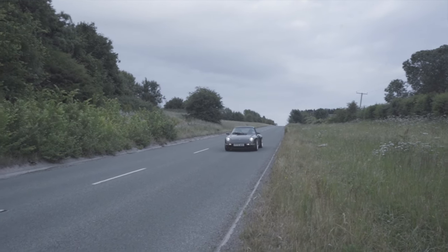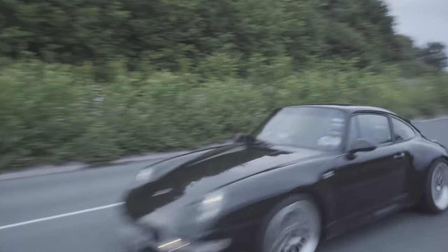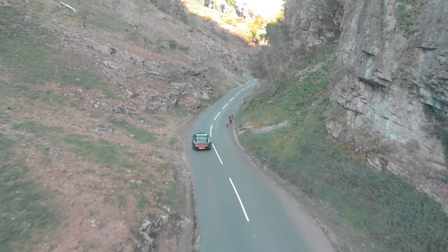Not bad for a 22-year-old car. As always with the 911 — especially the old air-cooled 911s — you never unweight the car, never unweight the rear end as you're coming into corners. You do all your decelerating before you get to a corner, never lift on a corner. Then, as you come round the corner, very early you can accelerate, because you've got the weight of the engine mass directly on the rear axle, which gives fantastic traction. So other cars may out-brake you, but you'll definitely out-accelerate them coming out of the corner.